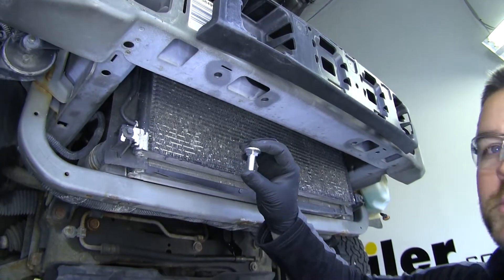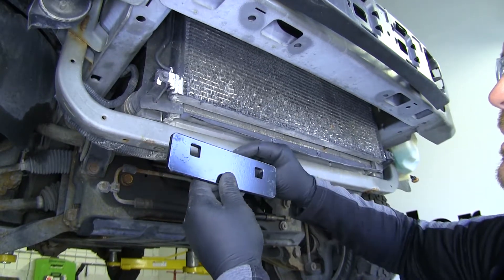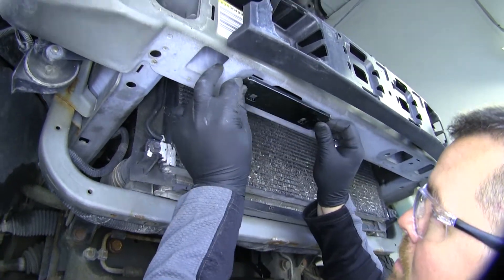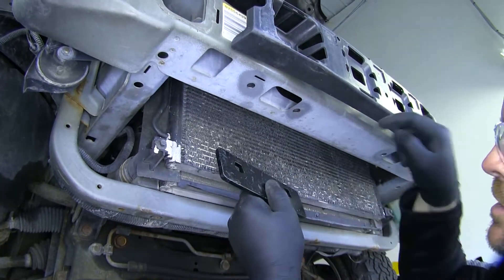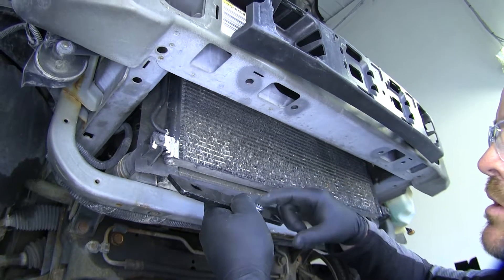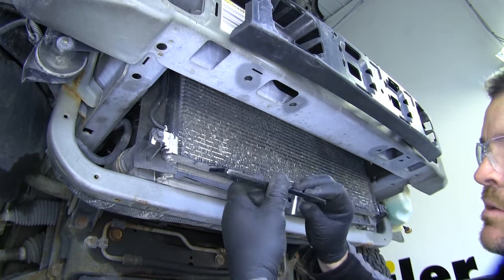We're going to take two half inch by one and a quarter inch carriage bolts and a backing plate. You'll notice that our holes are closer to one side and they're offset. We want to match the holes with the holes in the bottom of our bumper core. This side we want this closer edge towards the engine. Your instructions tell you to put both of them in and slide it up into place. However, you may push one out — there's a hole in the back side of the core that you can reach in and retrieve your bolt. I suggest inserting one at a time.